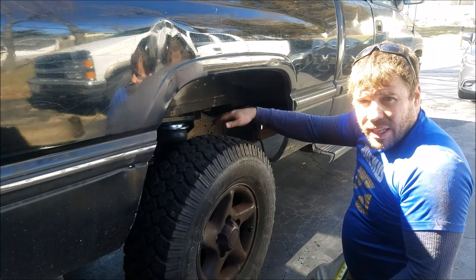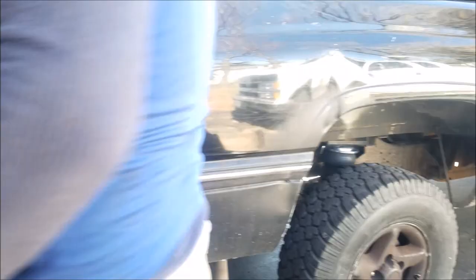That's what the airbag was already holding — it was at 10 PSI. So 10 PSI was already holding it up; just the airbag's height holds it. These were sagging badly before. We did 70 on the other side too — we're at 11 inches now. It's a little lower on the other side, but it could be the tire with more tread.